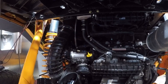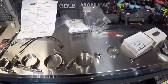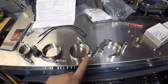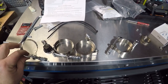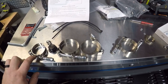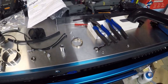We're going away from all the worm-style clamps and going to these fancy bolt clamps from EVO — standard 11mm, the kind you're used to on diesel truck charge tubes. Much nicer clamps — not going to pinch on any of the hoses, and they'll account for the larger diameter and thickness of the charge tubes. We'll get the small tube on the turbo-to-intercooler run first, then work on the larger one for the blow-off valve.